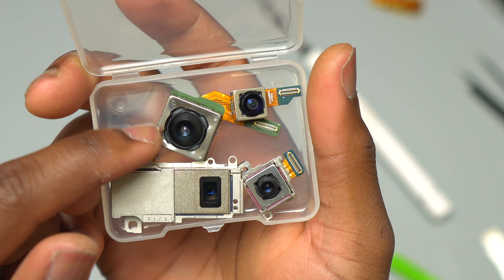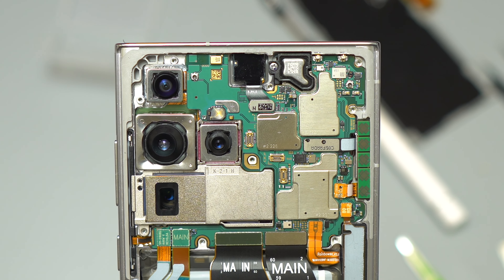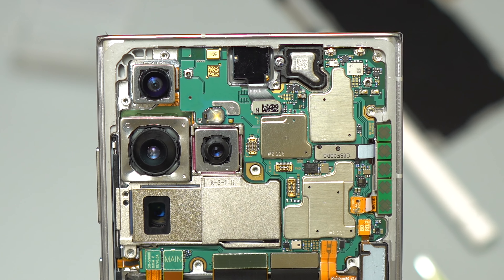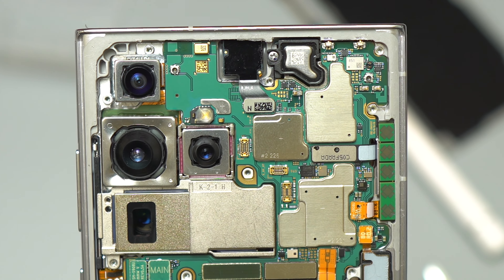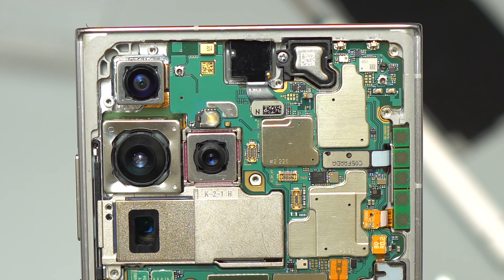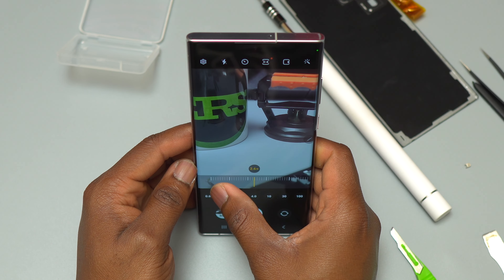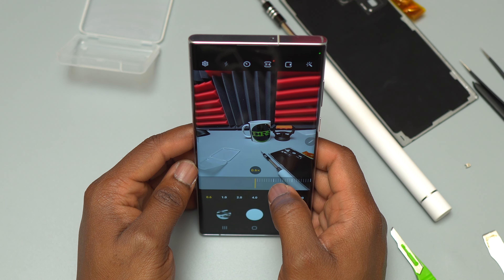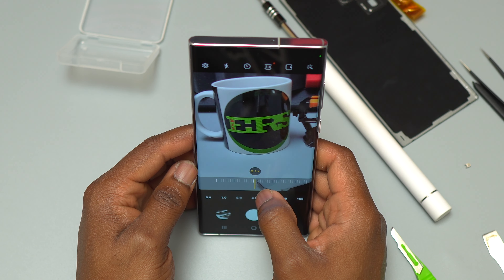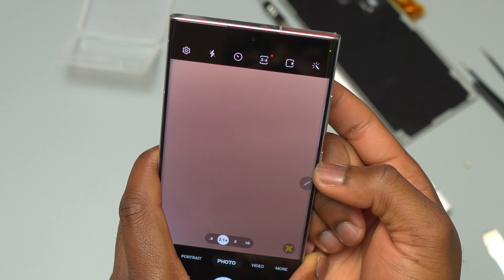All the cameras had been removed safely, but the main camera is the only one with some dents. Those dents can prevent the camera from using the OIS properly. I did make sure the OIS was working properly by pulling a little bit to indent the camera. I also tested the cameras — everything was working as if I didn't remove the enclosure. I did understand why they put that enclosure: it was for stability. Without the enclosure, with a small shift, you can see the camera is shaking — that is why they put that big enclosure in the first place.